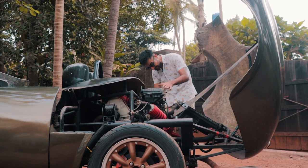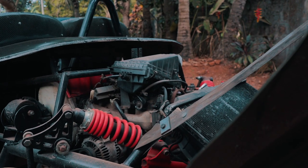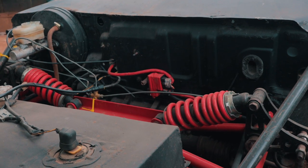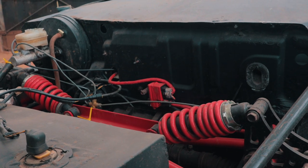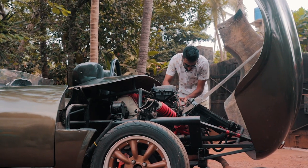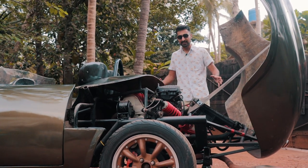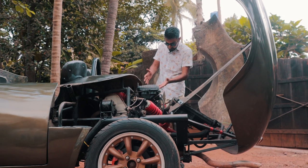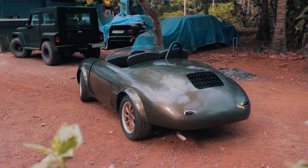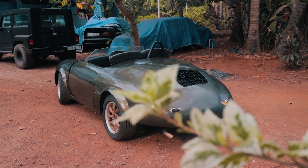This has a double wishbone suspension with a pushrod because this shell is quite a tight and confined space in the rear, so a conventional geometry setup would just not work. There's a pushrod near the wheel that moves the wishbone and gives you the suspension from a much more confined space. The subframe has also been completely redesigned to fit the engine as well as the radiator at a slight angle, with a vent on the side to get the radiator the most amount of air.